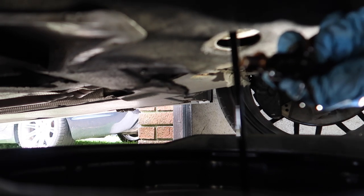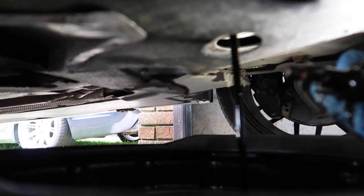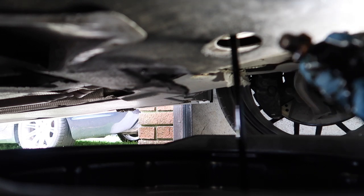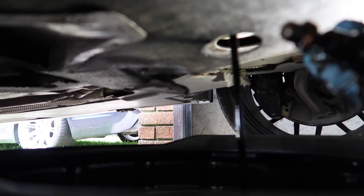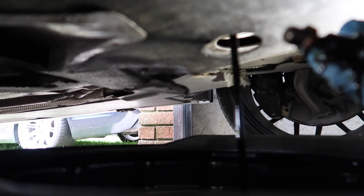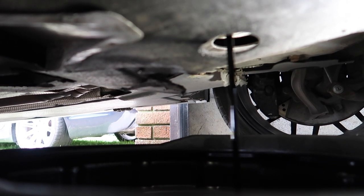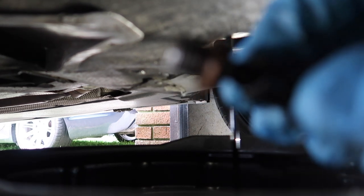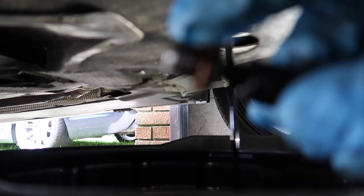As you can see we're now draining the oil out — that's the hole you drain from. We've got that draining. Then we're going to release the oil filter drain plug. As you'll see, it's the same 6mm allen key for both the oil filter housing drain plug and the sump plug, so you don't need to change tools — they're both exactly the same. While it keeps draining, be careful that when you take off your sump plug you've kept the washer.